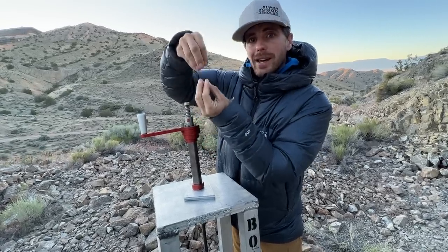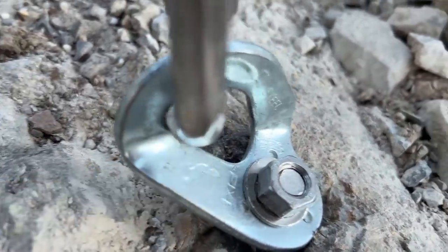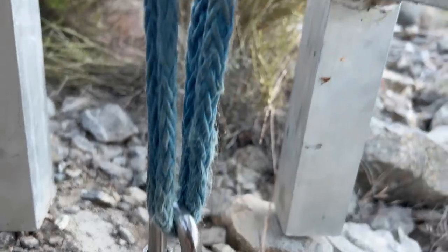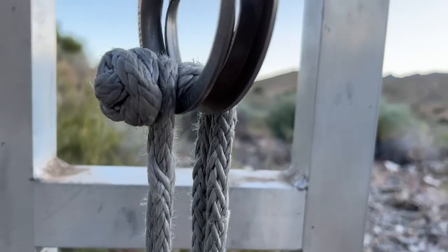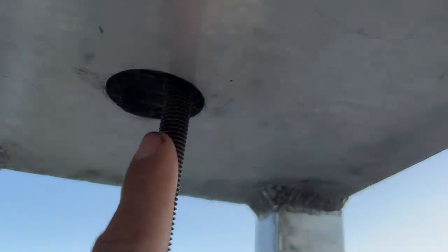What you do is spin it with a drill or by hand to cut a groove between the sleeve and the cone at the bottom so they come up together and don't engage. This is a long wedge bolt in limestone, and we have a quick link to a soft shackle to the line scale to a soft shackle to a Bonier hanger, to a coupler, to an all-thread.